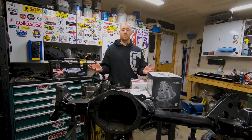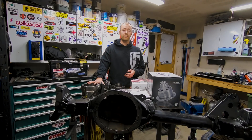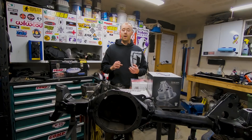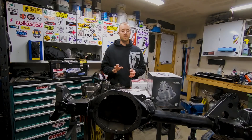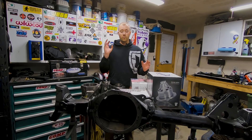The 609 axle — what the heck is it? Some of you might have never heard of that before. This is a hybrid axle taking the best parts of the Ford 9-inch, which is the center section differential, and the outer parts of a Dana 60 — axle shafts, hubs, unit bearings. Some use stock knuckles; I'm not — we'll get into that later. We take the best of two axles, combine them together, and build a 609. I've been collecting parts for this thing for over a year, and it's finally all coming to fruition.